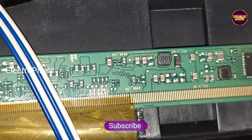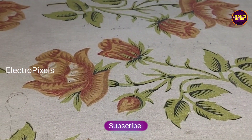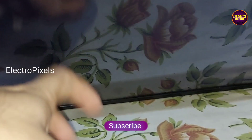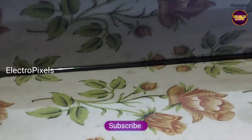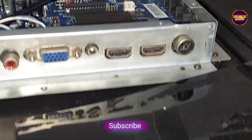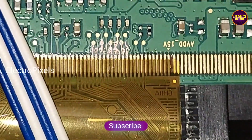The TV is now turned on, let us release it from standby. After cutting down the right side gate signal tracks, the complaint remains the same. This means that the problem is with the left side, so in that situation we need to rejoin all the cut tracks from the right side.